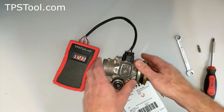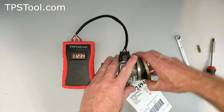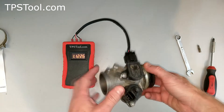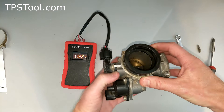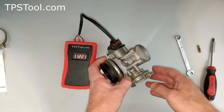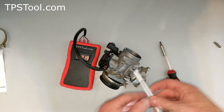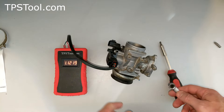So that's the good factory default right there — 1.12. This should run really nice now. I picked these throttle bodies up from guys who part out bikes, and let's have a moment of silence for the rest of this one — it was pretty rough when I got it, but it was untouched. You can tell by the mechanics paint on here that it was untouched. Now the TPS is set properly. To find out where the idle stop screw is set, you're going to need a flat head screwdriver and a 10mm box wrench for the jam nut. We're at 1.1219 right now.